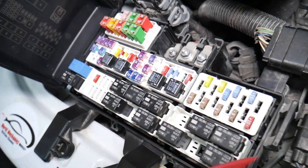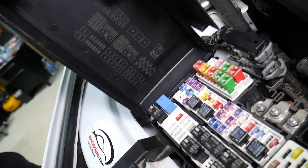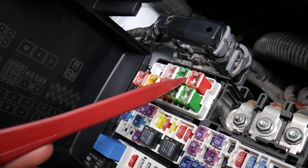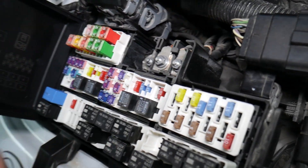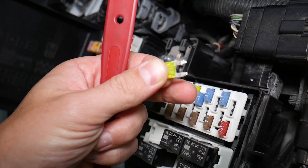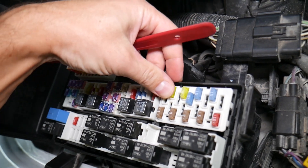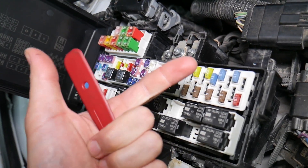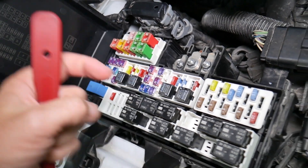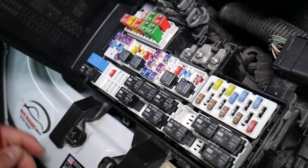That layout on the back corresponds to the fuse box itself. What's not convenient is that you don't always know what each fuse or relay is for — that's why we're making this video, to save you time and money. It is very important to test fuses and relays, because on those fuses you cannot clearly see if they're burnt or not. If you assume a fuse is good but it's actually bad — sometimes you cannot clearly see that — what can happen is you put the bad fuse back in and start replacing parts you don't need to. You lose time, you lose money fixing a problem that doesn't exist, when all you had to do was test the fuse and replace it. We'll put a link in the description to a video that will teach you how to test fuses and check relays very easily.